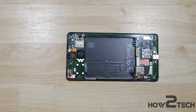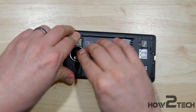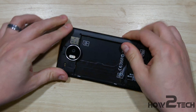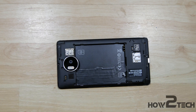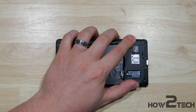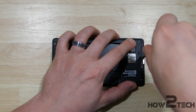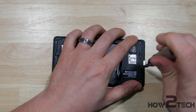All right, now with that done, we can go ahead and take the plastic housing and put it back on as well. Make sure the snap underneath the camera is back in. You can see that the matting is wanting to come up just a little bit — that's not a problem, we can fix that at the end or the battery itself will hold it back in place. We're going to go ahead and put all of the remaining screws in — there should be 12 of them in total. You want to put these in tight, but don't snug them down too much where it's going to bend or deform the screw head. You don't want to strip anything out, so make sure they're nice and tight. They normally have a little bit of thread locker on them that will hold them in place.